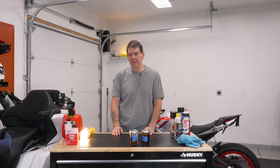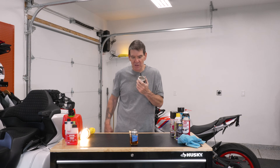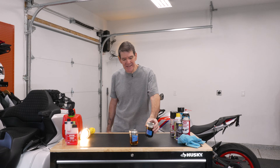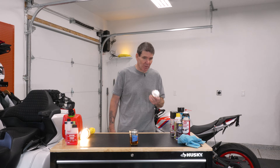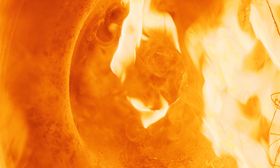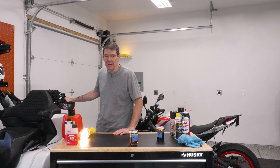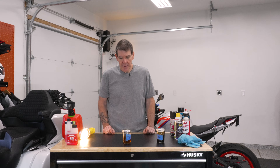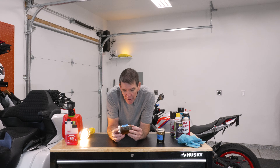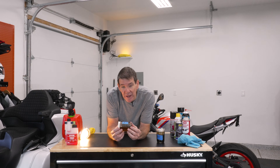Oil is in an environment with a lot of heat, a lot of friction, a lot of metal — so there are metal shavings in it. It'll also smell faintly of exhaust when it comes out, and that's normal. It also has an acid in it, and that acid will eat away at your engine. That's why it's important to change oil at the end of the season — we don't want to leave that acid sitting in there burning away at our metal parts. Now, a lot of people are going to tell you Honda says every 4,000 miles, and that's just fine — they know what they're talking about, it's their motor. Here's what I can tell you: changing oil is cheap, it's easy, and nobody has ever hurt their engine putting clean oil in it.